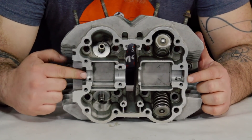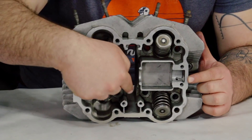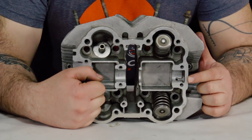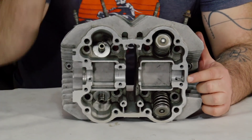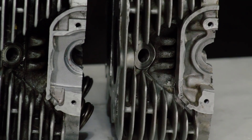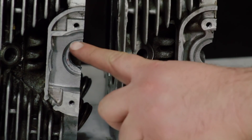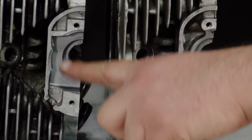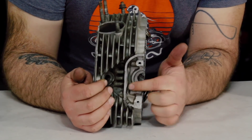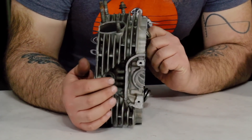If you have an earlier style cylinder head, you can actually come in from the side with a mill and drill a hole through it, then drill a hole into the cam journal here and pressure-feed it. But you need a milling machine to do the work, and not all heads are able to do it. This particular head has a lot of underfill on the casting — you're not going to have a good square shot to drill through it. Some earlier castings are all flat; it just depends how they made it. This later CJ casting has underfill where there isn't a lot of flat surface to work with.